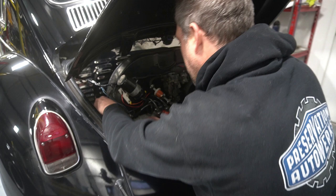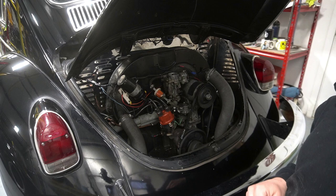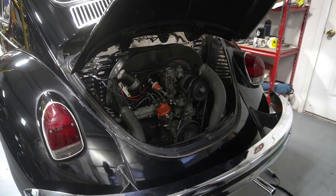We'll get the other two - you get the idea. Alright, we've got all the plugs changed out to the correct ones, they're all gapped. Let's see how she runs now. I'm almost positive that's gonna be it.